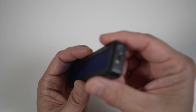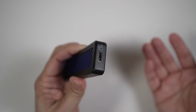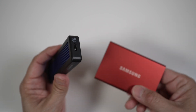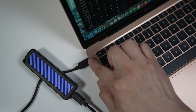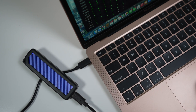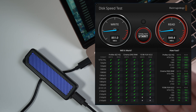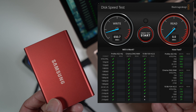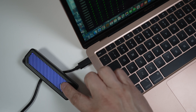This enclosure has a USB 3.1 Gen 2 port which supports 10 gigabits per second maximum throughput. It's compatible with both PC and Macs with up to 1000 megabytes per second transfer rate, similar to the Samsung T7 and the SanDisk Extreme V2. Connected directly to my M1 MacBook Air with Blackmagic speed test, I get about 850 MB/s write and 849 MB/s read — quite a bit faster than the Samsung T7, which was about 651 MB/s write and 656 MB/s read. So this drive can be about 30% faster in sequential write and read.